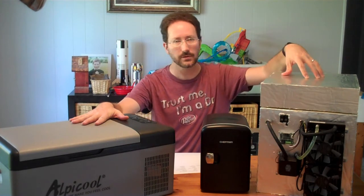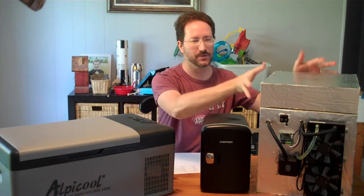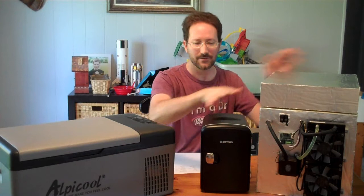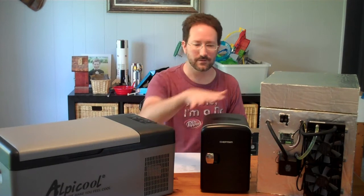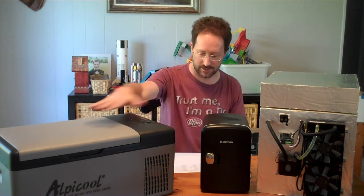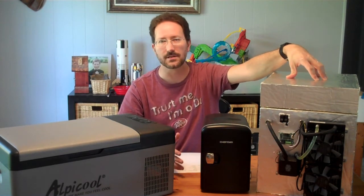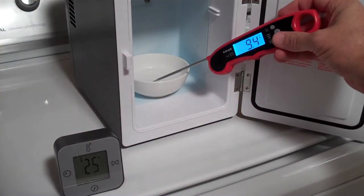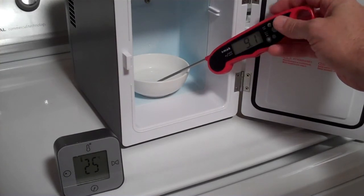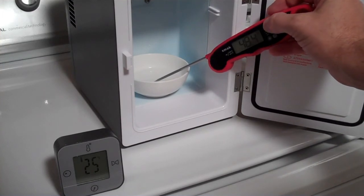The DIY unit and the compressor unit will not actually fit in the space of my van, so I'll either have to shrink the DIY unit or build one that fits. The thermoelectric unit would fit, but it doesn't get cold enough. From a price standpoint: the thermoelectric unit is $33 shipped, the compressor unit is normally about $170 — I got it on sale for $145 — and the DIY unit cost about $125 in parts. The thermoelectric unit never gets cold enough for refrigeration; the coldest it reached was about 8.5°C, and you need below about 5°C for refrigeration.